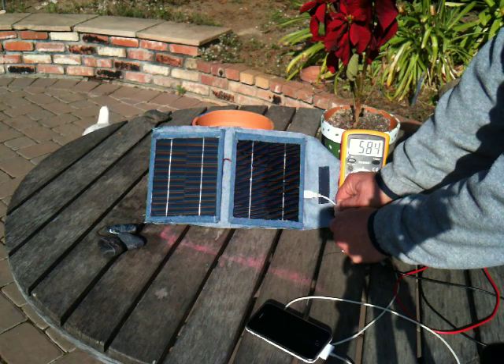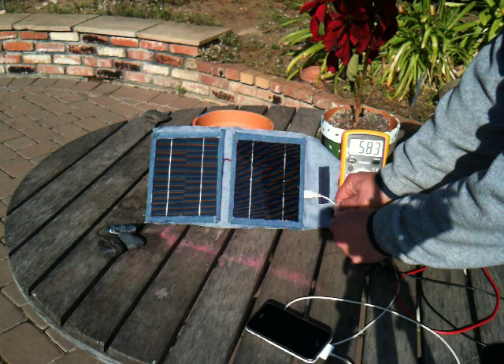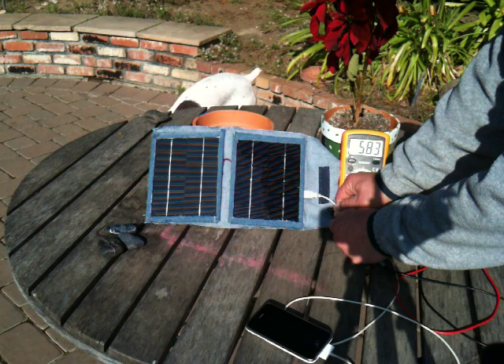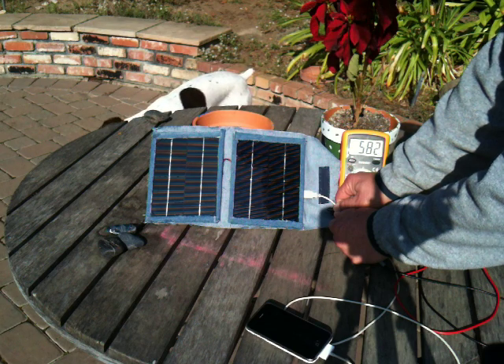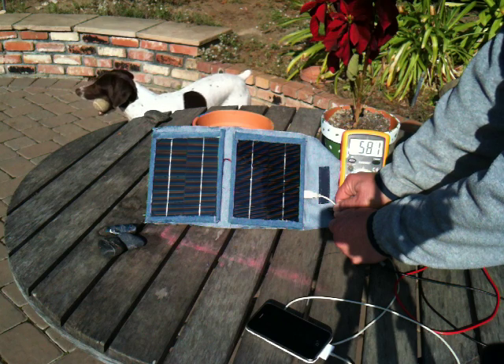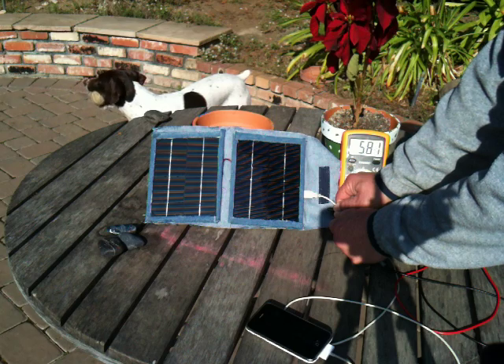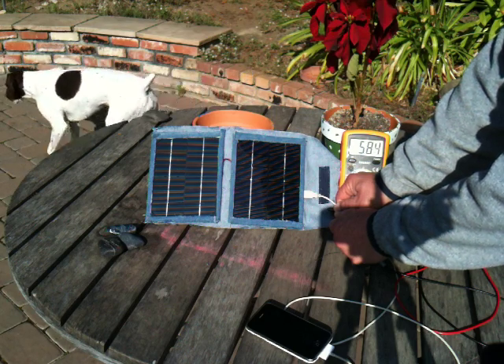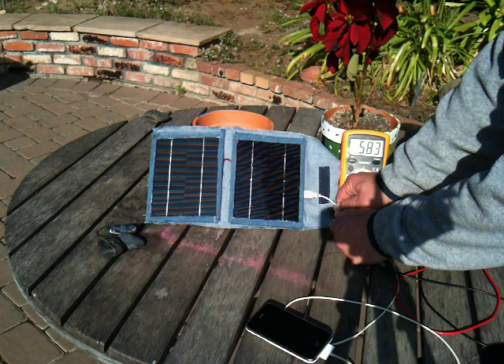You'll see the battery charging profile as far as voltage rise, stabilizing, current rise, and then dropping off. As this phone gets above 80%, the charging rates will drop down to the 200 milliamp, 100 milliamp range there at the end, which is pretty much the topping off. The bulk charging I've seen go from 800 milliamps down to 400 milliamps.